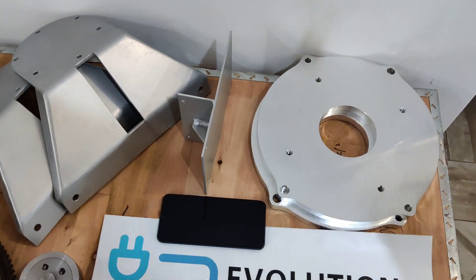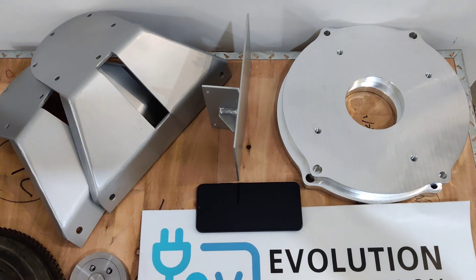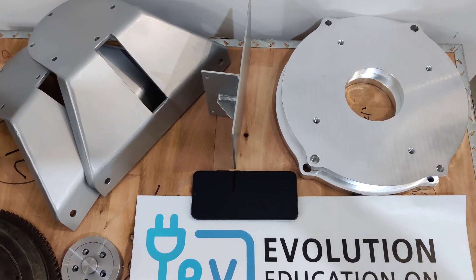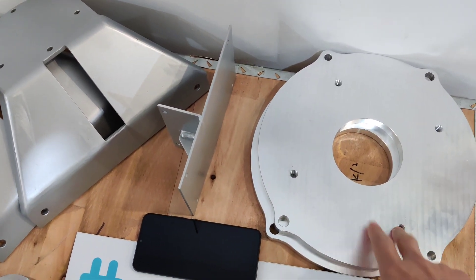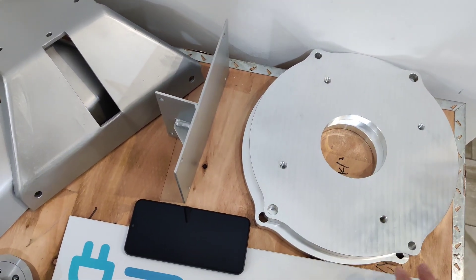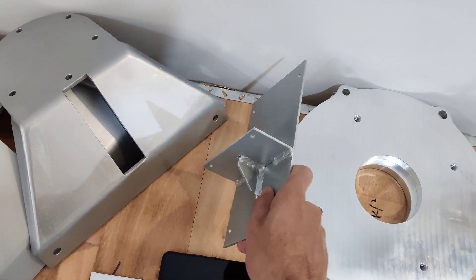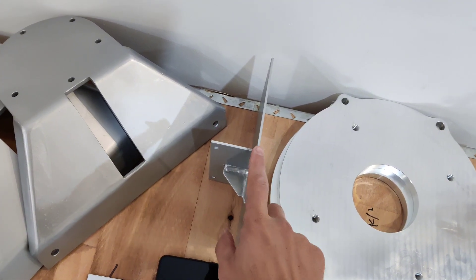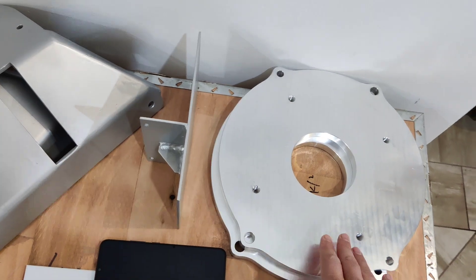We will start from the right side to the left side. To fit our 15-30 kW system on your Citroen 2CV, Citroen Mehari, or Citroen Dian, you need an adapter plate. This will connect the electric motor to the existing gearbox. This is the inverter or controller mounting part that also goes on the gearbox, so the gearbox carries both the controller and the electric motor.